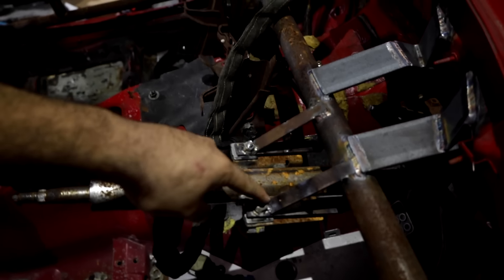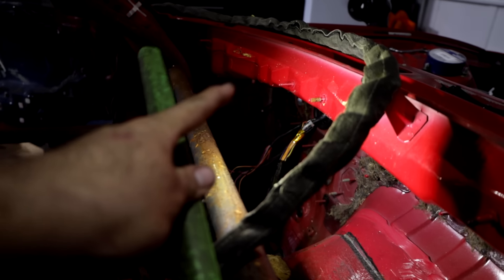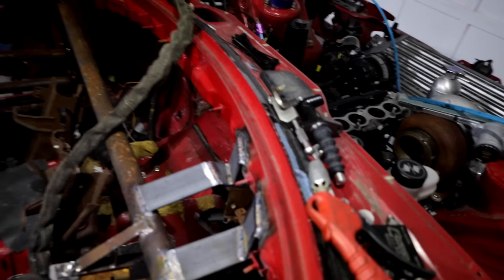Today I've been mostly working inside the car. The cage work is done but I didn't get to finish the steering column support bar, which I could have done if I had more time. I have to paint the whole inside of the car tonight, because tomorrow I'm getting a windshield and after that it'll be really hard to paint. I spent most of the day making these — just some flat bar with nuts welded to them to mount the steering column, with supports running from the firewall. The car was converted to right-hand drive, so the original pedal studs are gone. I welded new brackets so I can attach the pedals properly.